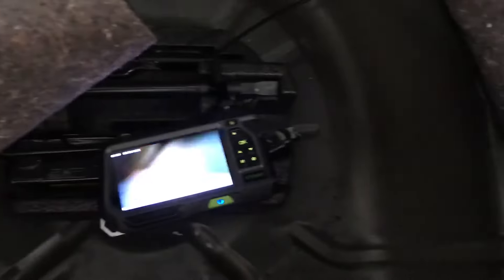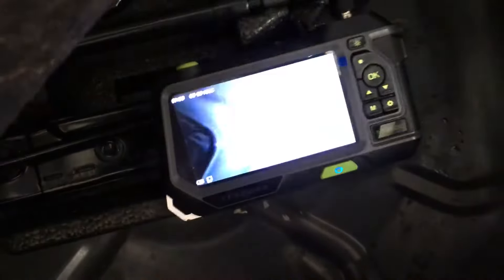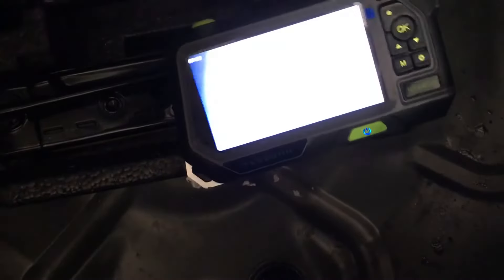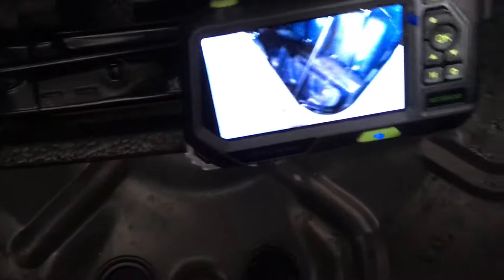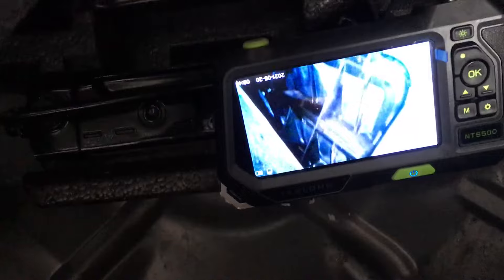We're going to test the rear air vents behind the rear bumper. We're just going to turn our hose on, and I've got my twisty camera down here — I'll just get this twisty camera in place. Okay, so this is your rear air vent which is behind the rear bumper, and when my colleague puts a bit of water up behind the rear bumper, simulating it being out in the rain, we should see water coming through the air vent.